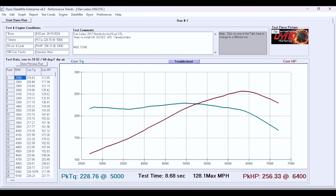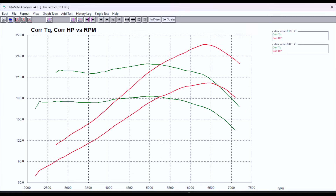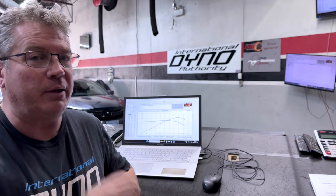At this point we've run through six or seven passes. We've picked up a total of 15 foot-pounds of torque and 17 horsepower. We're not overly excited about that. We think there's a possibility we should send this customer away to put some fresh new spark plugs in, gapped correctly, and bring them back to make sure we get 100% of the performance this should get. We're very used to six-cylinder Hondas running extremely strong and being very peppy, and this one just seems to be lacking even though it's way better than it was. Looking at where we are right now — 228 foot-pounds of torque and 256 horsepower — the entire torque line is up and horsepower follows. We just think it can be better, and we'd like to see if new spark plugs properly gapped will make it better.